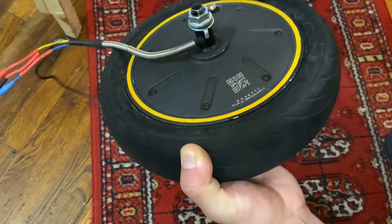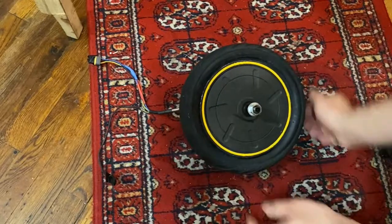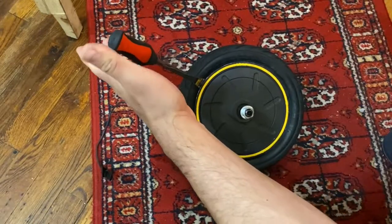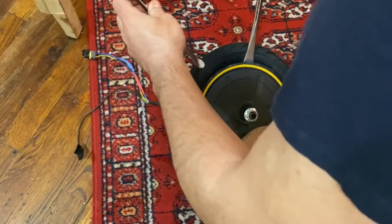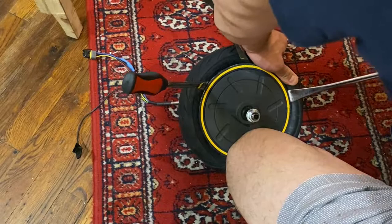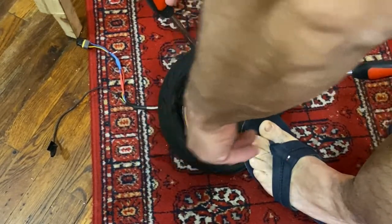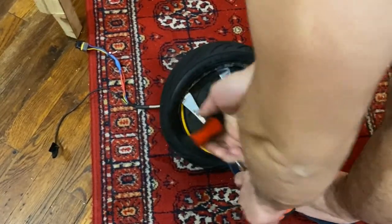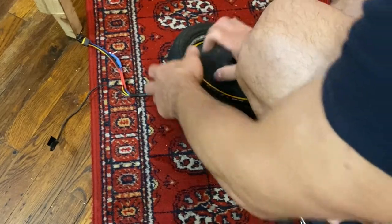The way I like to do it — I'm going to remove the tire through this side, because I don't want to be dealing with too many wires and having to do it twice. First, open it a little bit. First lever in, second lever, and do three levers at once if you can. I have three levers — one, two, three. Starting with this one, up, holding it with my feet. Second. And we have the tire out, completely off. That's it.